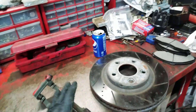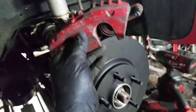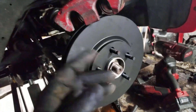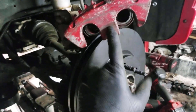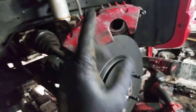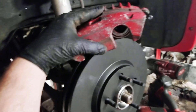Other than that, every single thing bolts up just like stock. What parts exactly are you going to need to do this upgrade? You can reuse your factory hoses, although now would be a good time to upgrade hoses if you were already planning to. You will need brake calipers for both sides — I got these off a 2001 Camaro from a pull-apart yard, which is the cheapest way. But these are only about $35 or $40 a piece new from a parts store. The only problem is they're probably not going to take your W-body calipers as cores, so you may have to pay the core charge. Another route is run to a junkyard and get a couple really cheap and trade them in — sometimes that comes out cheaper than paying the core. You are going to need post-facelift F-body front calipers, rotors to match, pads to match, and the caliper brackets. Reuse your hose — it all bolts up to the hub, no problem.